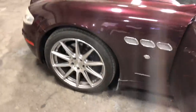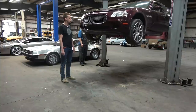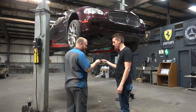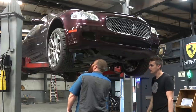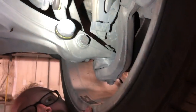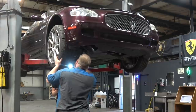Let's see if there's any leaks — what lies beneath? Hopefully this trident, the Maserati spork — Aquaman's weapon — doesn't end up stabbing me in the rear. I'll see if there's any leaks in the rear. Well, I have a nice hole here. Did you hit a duck or something? I didn't hit it. I also forgot to mention I have a little clunk in the suspension going over bumps. It doesn't feel quite as sharp as a Maserati should. Just push up straight up with the whole wheel. It's your strut — there's just a little bit of play in the strut. Am I replacing a strut or a strut mount? I could see if we can get the bushings; if not, it'll be the whole strut.